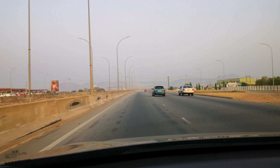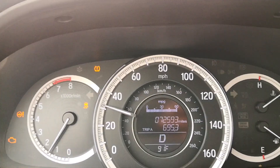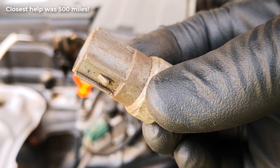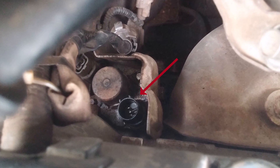Remember I mentioned how I embarked on a useless 500 mile trip back in the day. I had a P2646 on my 2003 Honda Accord. And if you know anything about Hondas, this code will usually put your car in limp mode, meaning I couldn't rev beyond 3000 RPM. Just imagine doing a 500 mile trip with this, only for it to end up being that the code was being caused by a poor contact in the connector for the VTEC switch.